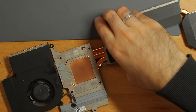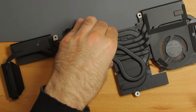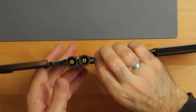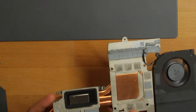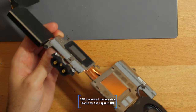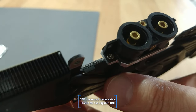To build my own water-cooling solution for this laptop, I will obviously need to mod the heatsink and solder on some kind of water pipe the water can flow through. So I thought, before we try anything custom-built, let's make use of an existing system first. So I called for help at XMG and they sent me a replacement heatsink for the XMG Neo 15, which integrates a water pipe right on top of the heat pipes.